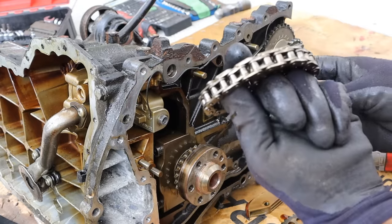Looking under the engine head, it's a very simple 4-valve design — 2 intake, 2 exhaust. The semi-closed block design continues here, bringing coolant around the exhaust valves to cool them down. This head bolt hole actually doubles as the oil passage which brings oil to lubricate components inside the head. Looking at the top of the head, you can easily see the oil galley that runs along here — one for each side. That's where these little roller arms sit with hydraulic lash adjusters. Oil pressure builds up behind them, taking up any slack between the roller and the camshaft as it rolls around, so you don't have to adjust the valve clearance. The intake side features variable valve timing with a VVT solenoid that takes oil pressure and sends it through little holes in the camshaft, allowing the phaser to rotate for better efficiency during combustion.